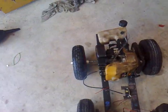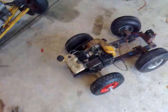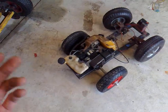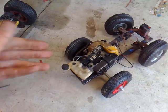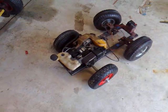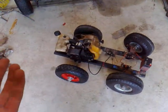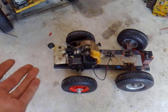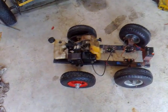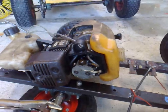It's going! It was flooded. I basically just cleaned the spark plug because it had oil over it, cleaned up the cylinder by taking the spark plug out and giving a few hard pulls, and now it's going again. This one is tuned, but for the purpose of this video I'm going to detune it and then tune it again to show you guys how to tune it.